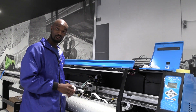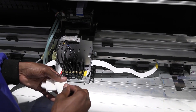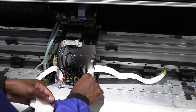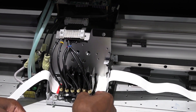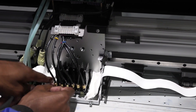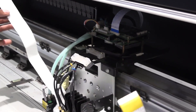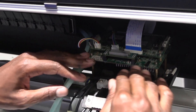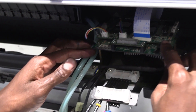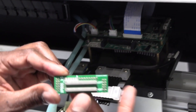That's done, and the next thing I need to do is plug the cables into the circuitry on top. It is also good practice to keep a bit of tissue here — it may not be aesthetic, but it will show you if there's any ink flowing. These are my two cables: as I face the printer head, this one is on the right and this one is on the left. There is a carriage connector on my carriage board right here, and whether you have a single-layered or double-layered carriage board, they will all have this connector in common.